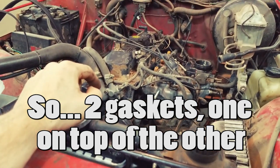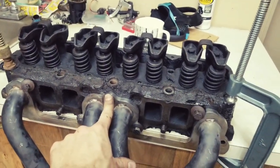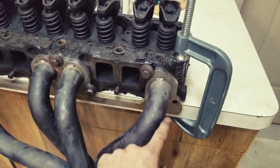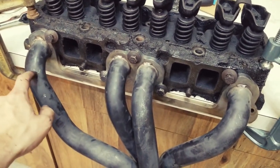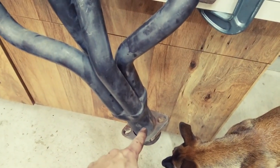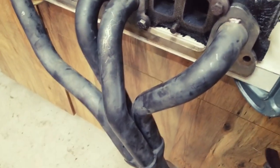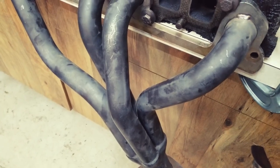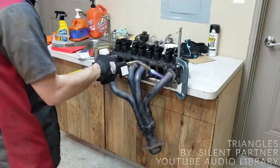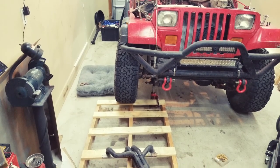Here's the game plan — though it's probably not going to work. I've bolted onto this old head and clamped it to the table. I'm going to heat as thoroughly as I can in these areas until they start to glow, then push down with my foot. The goal is to move this towards the table about a quarter of an inch, which is the most we can do.